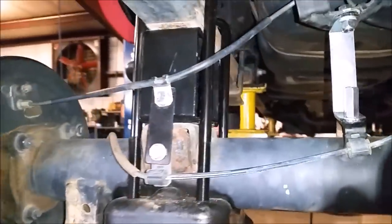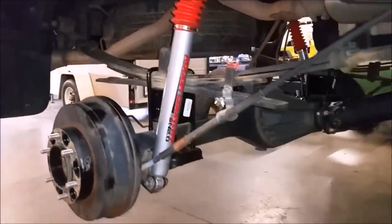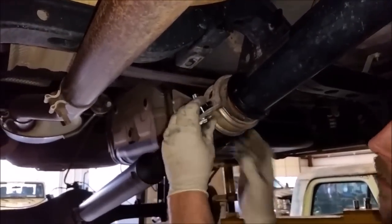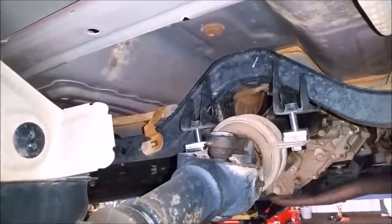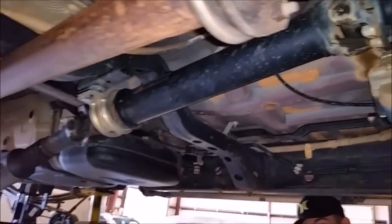We're now working on doing the extensions for the brake cables. We're working on installing the shocks. We've now finished up the rear end — the rear shocks are in place, you can see the rear blocks, and all of the brake line brackets have been installed. So with that done, we'll go ahead and install the driveshaft shims. To start, we're going to remove the two bolts holding the carrier bearing in place. This kit came with six shims and we're going to use two on each side, placing them with the supplied bolt and tightening them down. Since we are adding such large rear blocks, it's going to increase the angle of the driveshaft, and the shims will help maintain a factory angle of the driveshaft, preventing excessive wear on the transmission or the differential.